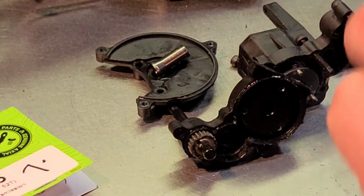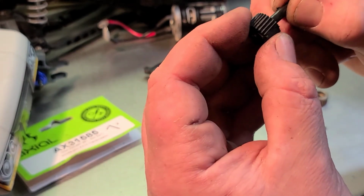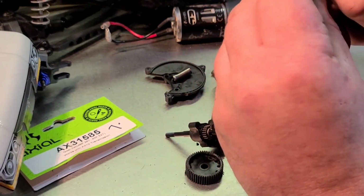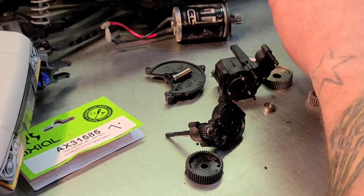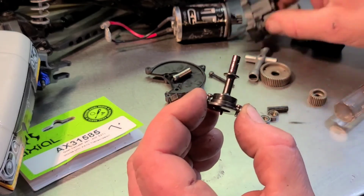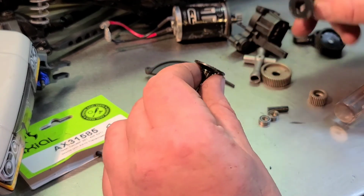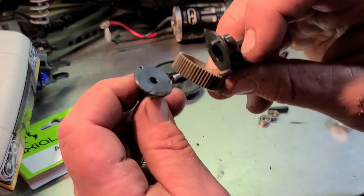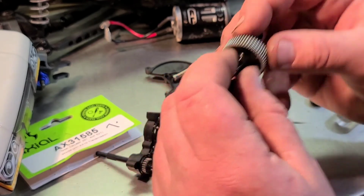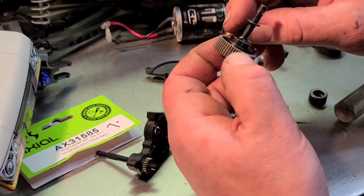All right, that differential sounds good. Yep, that differential sounds good. Yeah, you see that? It's not spinning there. Our yokes here are outdrive, so we're gonna get this case tore apart. This piece over here off. Gonna have to upgrade the spur gear because I know I'm gonna strip that out one day, especially upgrading this transmission. We're gonna put more force on this spur gear now, so that's probably gonna be a future upgrade. Get that motor out. We're gonna blow it out too while we got this thing apart.